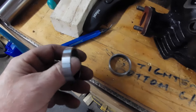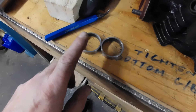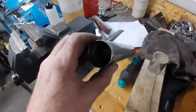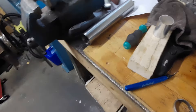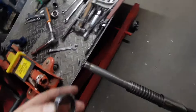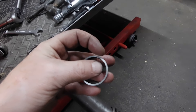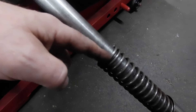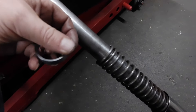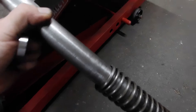I've just made a couple of spacers — they're only about 10mm thick — just to put some preload on there. I used an old Honda VTR1000 stanchion. They could have been a little bit wider, or I could find a flat washer just to go around there, to give it something a bit more to butt up against.